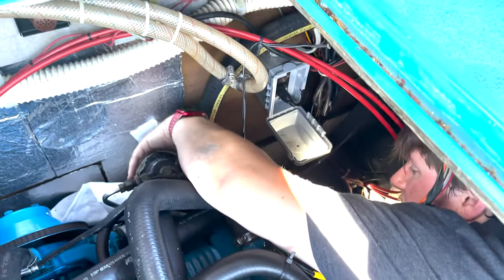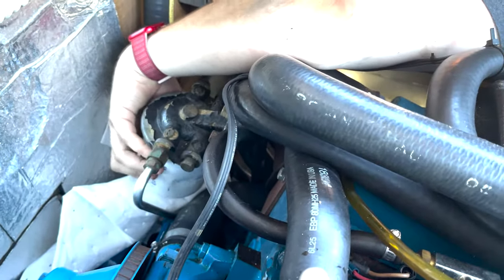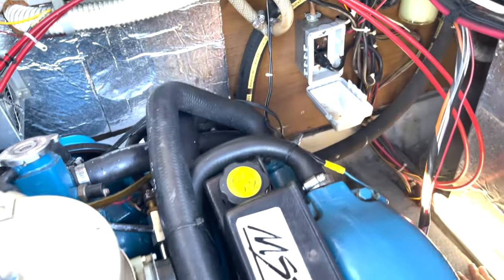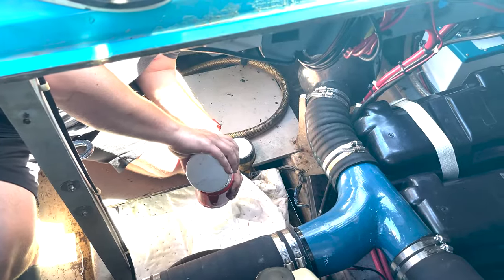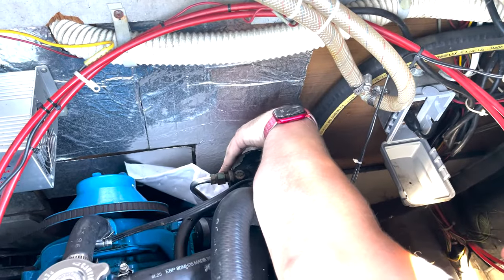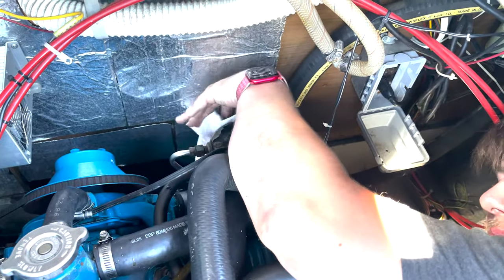This one's going to be a little more tricky because it's right out the front, so I've got to climb all up in here. Just prepping absorbents just in case I spill any fuel — try to absorb it up. There we go. Now we just need the new filter. Install it back where it came from, and make sure you definitely run the blower fan after you are done doing all this so you can get all the fuel fumes out of your engine bay.